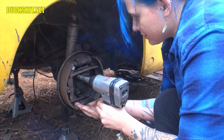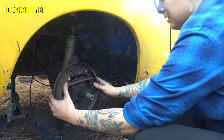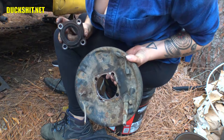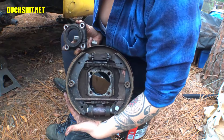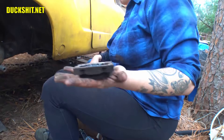I'm amazed how much air this thing has left in it — everything came apart pretty easy, we didn't have to run it too hard. That entire plate should come off — there it is. Show us your prize: you've got an entire brake mechanism. The parts in it look pretty good. The wheel cylinder, though, is not going to be in any good shape at all — it looks pretty nasty and corroded. We'll get rid of that; no reason to keep it around.